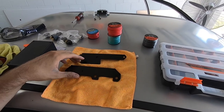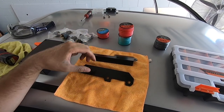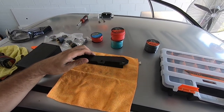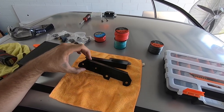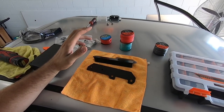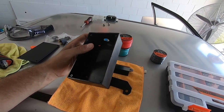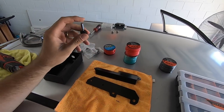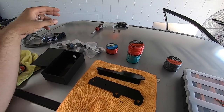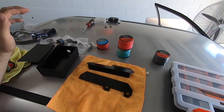We've got our brackets painted up. This one will sit on top of the mounts for the shifter, and the other one sits this way. The reason I used 3mm aluminium angle is for the stiffness factor — I don't want it to rattle or flex, just sit firm in the car. This was 50mm by 25mm aluminium angle from Bunnings, about $15 for a metre. The jiffy box already has the holes cut in the base for the bolts and a hole for cables to run through. In the lid I'll be drilling the holes shortly for our six switches, then we can mount it all up.